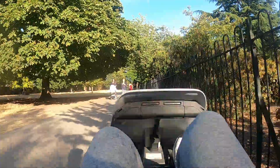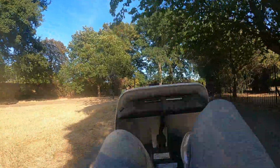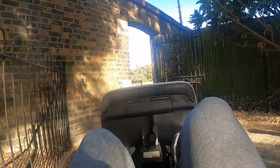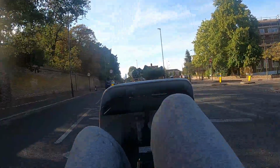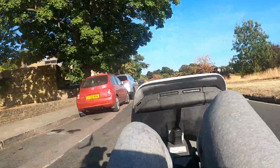Yeah, it's going to take some practice getting used to the front brake to find the best amount of force for actual braking instead of just locking up the tyre. So obviously once the tyre is locked, you've broken friction and you get less actual braking power. Right. Beep beep. Okay. Whoa. Has that? Yes, it has. So I need to adjust the right grip a little. If that's now setting off the horn on full lock. And yes, it did trip the motor cutout.